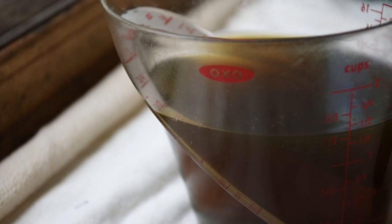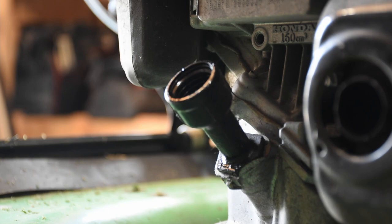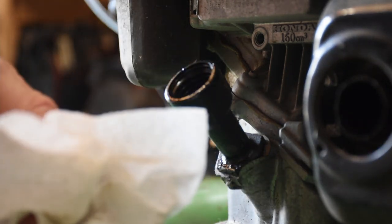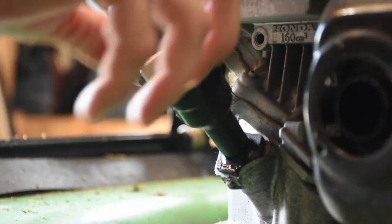We're going to add it down through a funnel just to keep it clean. One thing to remember is anytime you're adding oil through a funnel like this, you want to add it slowly so it doesn't back up and overflow over the back of the funnel and make a mess everywhere — just take your time. Now we're going to check the dipstick to see if we got it right. You just put this in — you don't actually thread it in, you just touch it, pull it out and check the oil. This one's good, so we'll just tighten this up and move on to the next thing.